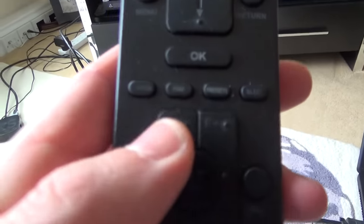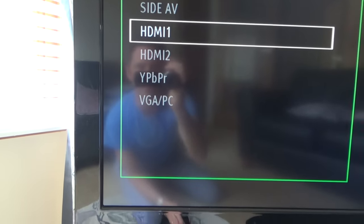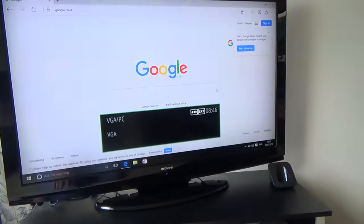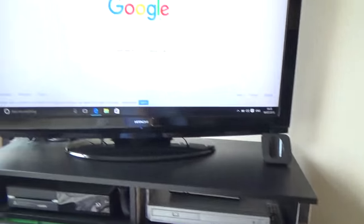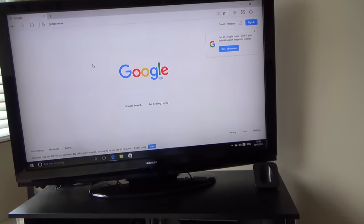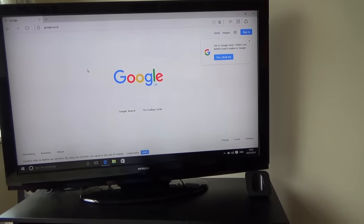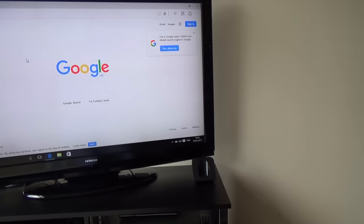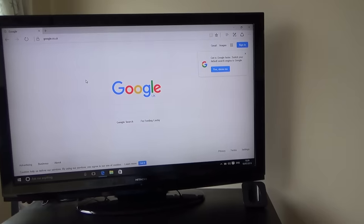Whatever's on the laptop will now appear on the TV. Go to Source on the TV and select VGA/PC. There are different display options: you can duplicate your screen, extend it, or have it working only on the second screen. If the kids want to watch a movie, I'll blank the laptop and use second screen only. If you're doing work with a smaller TV next to your monitor, extending gives you more workspace.